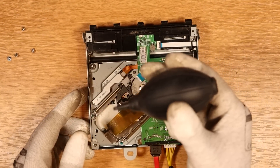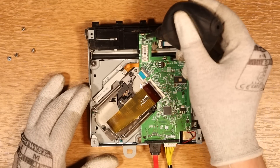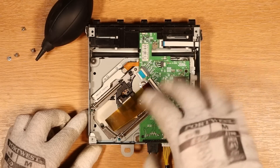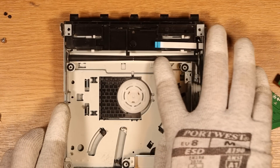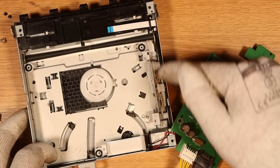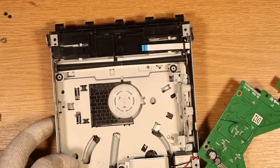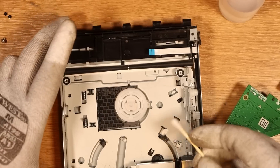For something as delicate as this, I do have my little air generator — we'll call it that — just to get any dust out. A can of air is also a good option. I'm going to take this little board out and see if there's anything evident underneath. I think the two main culprits are either going to be the rollers or the gears down here. Because I'm completely inexperienced with gears, I'm going to clean off the rollers and give it a good clean. I'll squirt some IPA on my cotton bud.